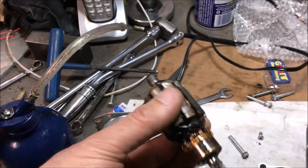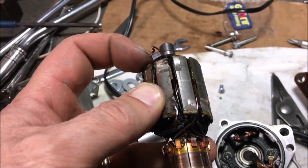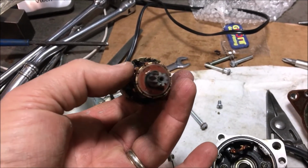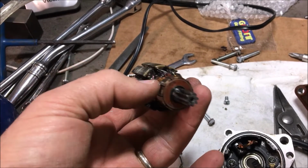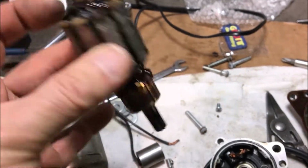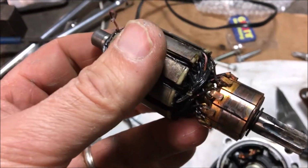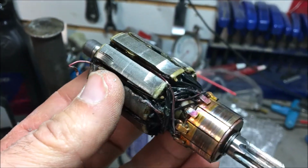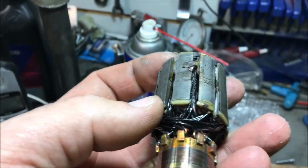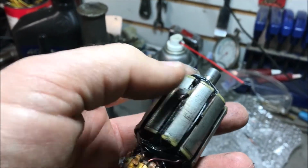Furthermore, take a look at this. So I pulled out the armature and the wire is completely disconnected. So we have one of these, I guess what you'd call it, a pole. One of these poles is totally disconnected, and that might affect 2 poles, right? Okay, you can see here it's cooked. It's baked pretty good. You gotta look and see, but it's all black and that's carbonated there, and the reek out of this thing, and there's more metal there. More metal.